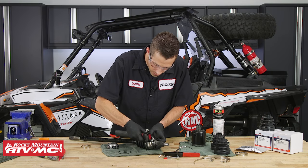Before installing the racing cage, take a little bit of CV grease and coat the splines on the shaft. Then take the racing cage — remember, the smaller diameter faces towards the center of the axle and the larger diameter faces towards the plunging joint. Install the snap ring with snap ring pliers, and give it a good inspection to make sure it's fully seated. Pull the axle out of the vise, place the plunging joint end into the vise, and coat the inside of the plunging joint with grease. Place the axle shaft into the plunging joint and install the circlip — make sure it snaps into place and is fully seated. Then take the remainder of the grease and fill the plunging joint, emptying the grease package entirely into the joint. Move the joint in and out several times and work it around in circles to distribute the grease throughout the entire racing cage.